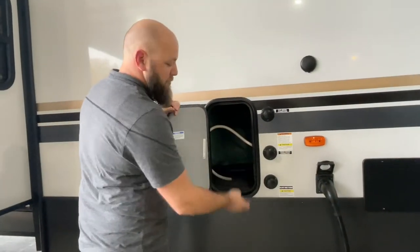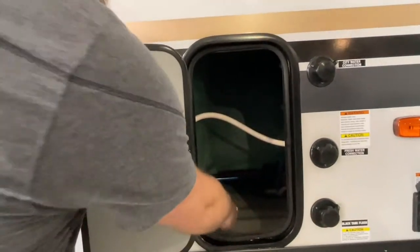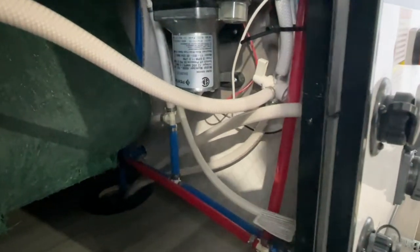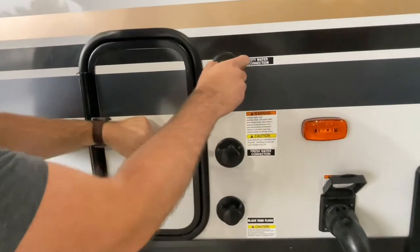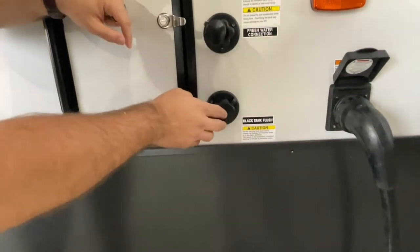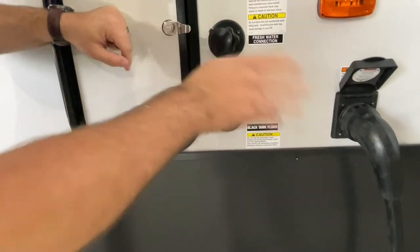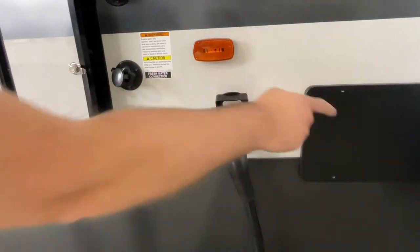Right above your tank drains is where you access winterizing. There's a hose here — you'll hook it into a gallon jug of winterizer. There's a valve on the side; you'll twist it, turn your water pump on, and let it suck antifreeze through the system. Directly beside that, you have your water connection for hookups at a campground. If you want to boondock, you'll fill this fresh water compartment. This right here is a black tank flush — hook a water line to it, pull your black valve, and it flushes your system. Directly beside that is your 50-amp hookup and your furnace return.